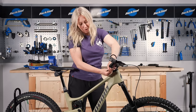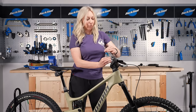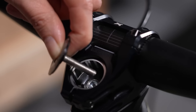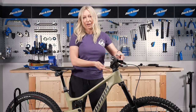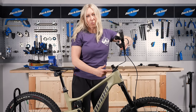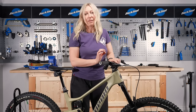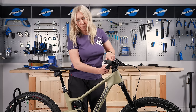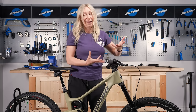Once you've released the bolts, unwind the top cap completely and it will come up. This top screw screws into a star nut inside the steerer tube of your fork, and that's what compresses the front end together. Once that's out and the bolts are loose, you can lift off your stem. Depending on what stem spacers you've got underneath, you can lift them up, put the stem back down, and put them on top. Make sure you keep that stack order because you will need a gap at the top of the steerer tube to create a good clamp and stop your headset from rattling.